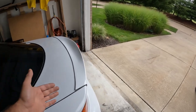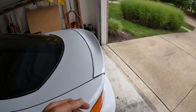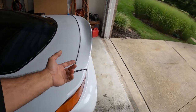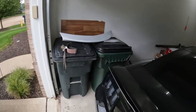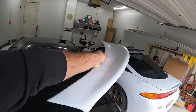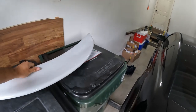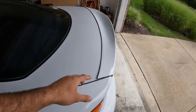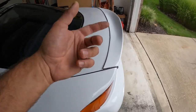I'm going to be pulling it off in a minute. I don't really care about damaging the wing, but obviously I don't want to damage the trunk, so we'll just try to pry up on it. I might end up having to use some fishing line or something to cut the glue. Here is the new wing — it's basically the same idea but a lot taller, and it's a much better made wing. It's also ABS plastic, so it's a lot easier to work with and easier to change the shape versus fiberglass.